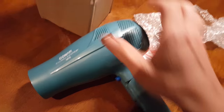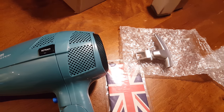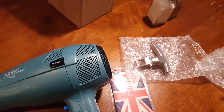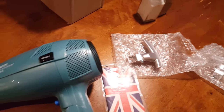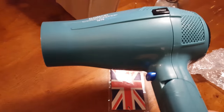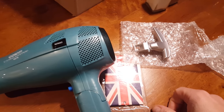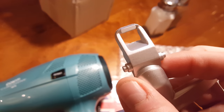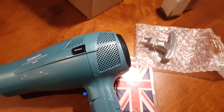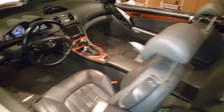What you're going to need is the paddles and a hairdryer. The factory shift buttons sit in a plastic carriage — like a bolt going through a hole. To get the factory buttons out, you heat them with the hairdryer until they're almost too hot to touch, which makes them more pliable. Then you take a small screwdriver and pop the buttons out. I've got the top down for easier access and lighting.